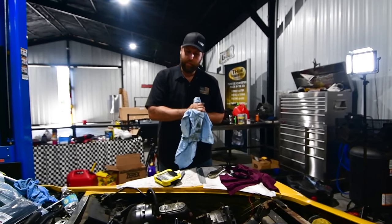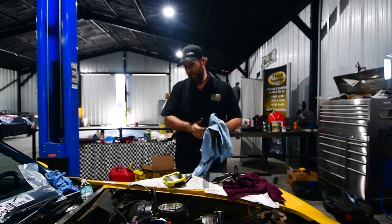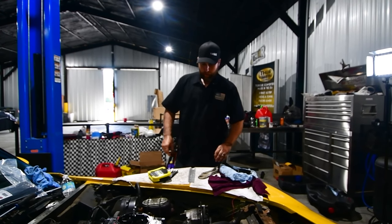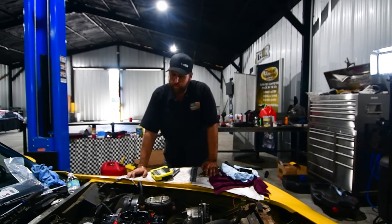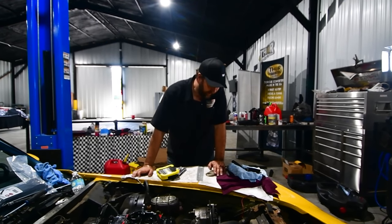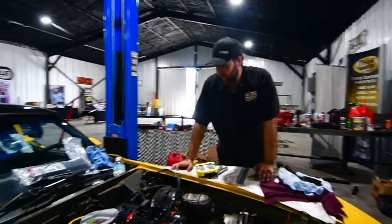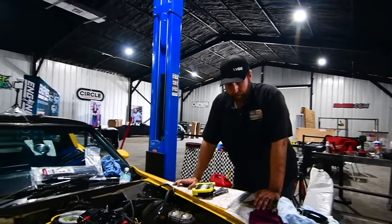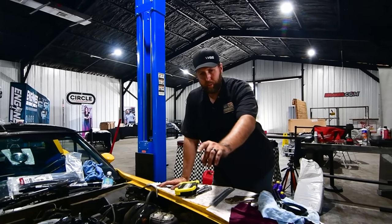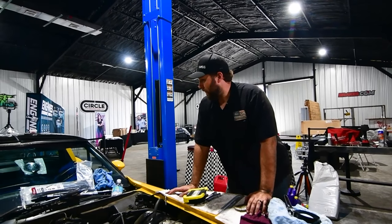And then we're gonna fire this thing up for the first time with a blower, new carb. And I'm confident it might run. There's a 72% chance, no, 81% chance that it'll run. I do need to get my timing light out and ready. Go over the fuel system quick. Make sure the electronic is plugged in for the old lightning whirler. We're not gonna run it long enough to worry about coolant or the fan or anything like that. I just wanna hear it fire.